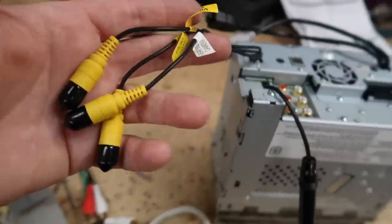These RCAs are for cameras, these are for audio, and these are the USBs. So what this frees us up to do is feed in the rear seat entertainment RCA into that AV jack. We're going to need an eighth-inch to RCA adapter — it's just an aux jack with some RCAs on it — and then we'll plug it in. That way they're going to get the DVD sound into the auxiliary. That's the course we're going to take to make all that function the way it's supposed to.